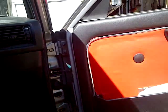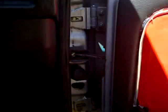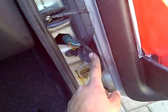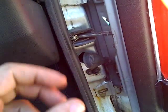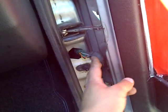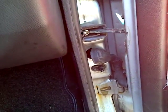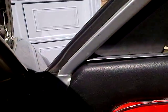First, I was suspicious about my power window because once in a while it would just not work at all. I took the cover off and saw the terminal was rusted, with a lot of wires that had a green deposit from the battery. There was no way to put it back after cleaning, so I cut it out completely and soldered the wires back together. After that, my power window and power mirror were both working fine.